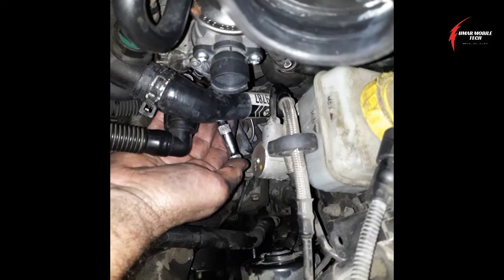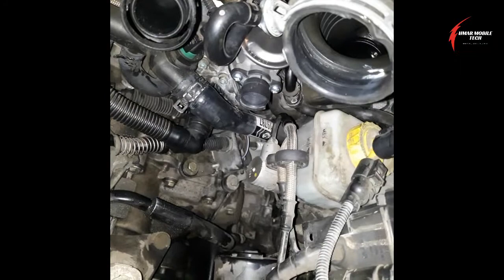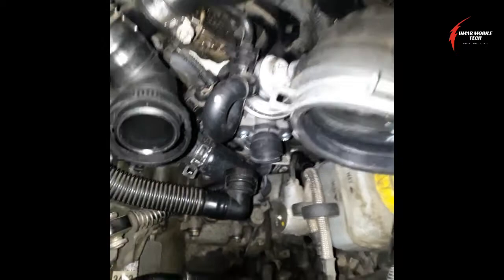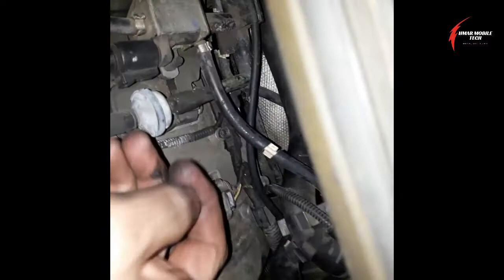You can always go back and add another eighth or tenth of a turn later if there are any leaks. This is the way I did it — in this case, there's just no way to get a torque wrench in there. Once everything is good, I found that using heavy duty silicone spray on the hose ends that go back onto the combi valve, the air cleaner box, and wherever you're reconnecting them — since they have a rubber O-ring — really helps lube things up and makes reassembly go together like butter. Make sure your coolant hose is back on with the clamp in place, the vacuum hose is connected and routed properly, and the wire loom connectors are all routed back correctly all the way to the solenoid.